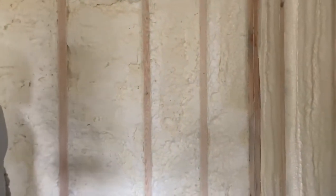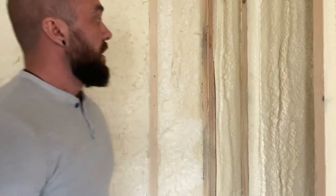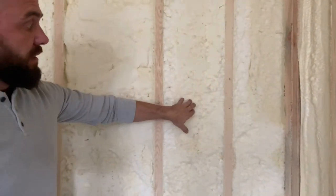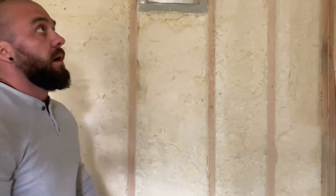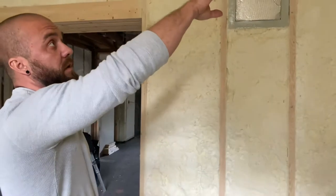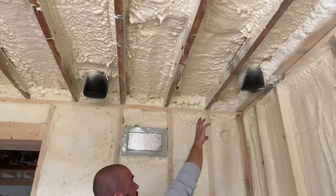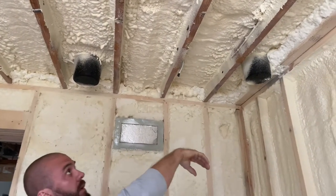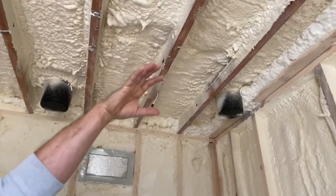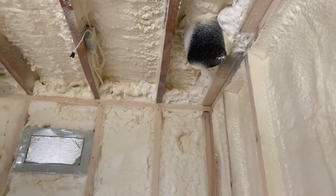Just for extra soundproofing. If you look, you can see the difference — this closed cell is very hard, so it's really good for insulating. Where they did the open cell, I can literally push my fingers into it, so it's going to really absorb the sound. And where we did our buckets for our speakers, they went ahead and did the closed cell around it, but I'm still able to cut in and access everything through this foam.